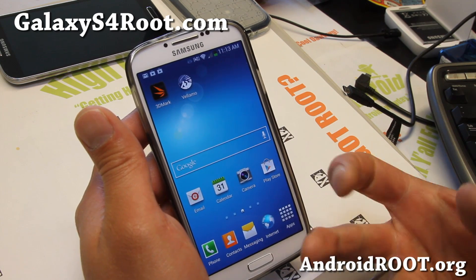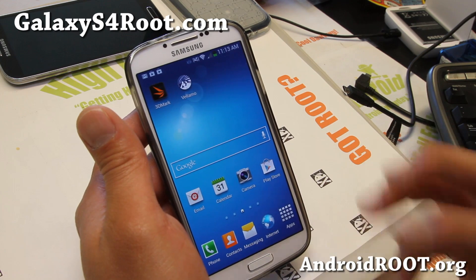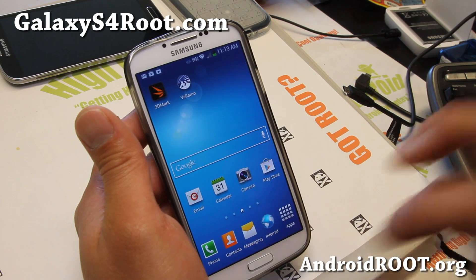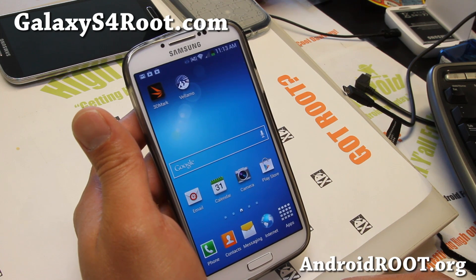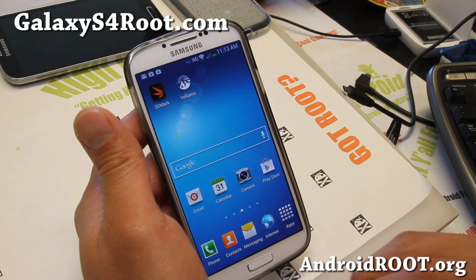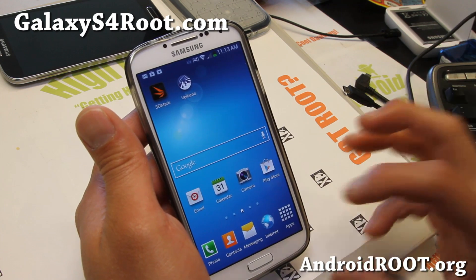This is really a method for getting your phone back to completely stock — also great for returning your phone for warranty. Before we begin, if you have a rooted Galaxy S4, do run the Triangle Away app, which will reset your binary counter to zero.